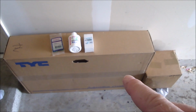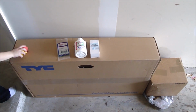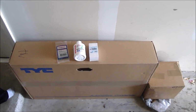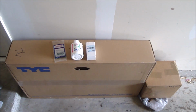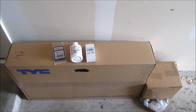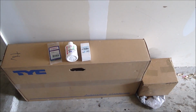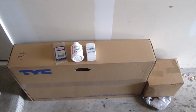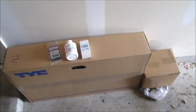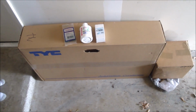And you don't have to order the entire condenser if you don't think there's any debris clogging it up. You can just buy the element for the air dryer instead. But everywhere I looked, they always recommended to change the condenser. So we're going to change the condenser. It's not that expensive. It's just $40 some. The remanufactured compressor was 120 some bucks, and then the expansion valve wasn't very much. I can't remember. But I'm also going to change the belt while we got the old one off, and we'll go from there.